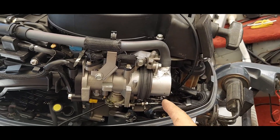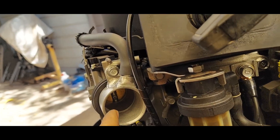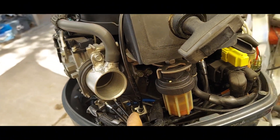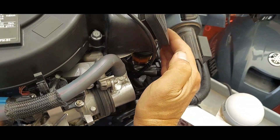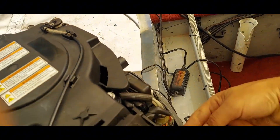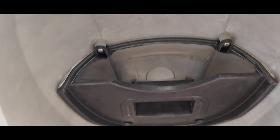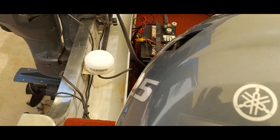So I modified the intake — I use an inch-and-a-half tube. The throttle body is actually smaller than the intake, which is fine. There's a little step in there, it's not a perfect laminar flow, but I'm not worried about that. I shortened the intake because if it's too long, the cowling itself will block the airflow. Now the air is able to be pulled in from the cowling through here, as well as through this side all the way around like it was originally designed. I also made a big window so the engine can breathe as much air as possible through the ports — it has a side vent, side cowl, and the rear.